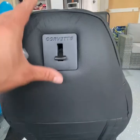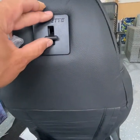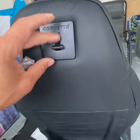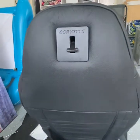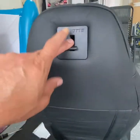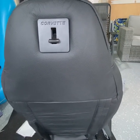So this is the bezel installed. Masking tape is your friend - mask off the horizontal and vertical. You want to position the lever about center, slot horizontal, then slowly push it into the cavity, rotate 90 degrees so the bezel is vertical, adjust it and snap it into place. Also make a mark where the Corvette logo is so you don't install it upside down. This one is a little thicker but they look pretty good - the driver's side has the same thing.